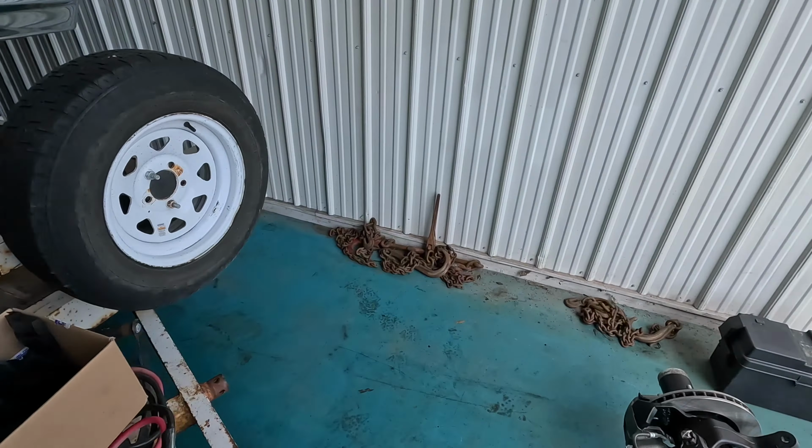For example, I took the steering shaft off, and looks like somebody did some customization of the rag joint. Check this out. It's pretty cracked up, but you'd think that was just a normal rag joint. I'm pretty sure a normal rag joint has a hole in the middle here. I think this is either a chunk of mud flap or like a sidewall of a tire. Whatever it is, it's not for steering components, so that's got to get changed.